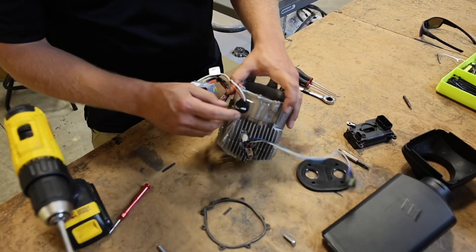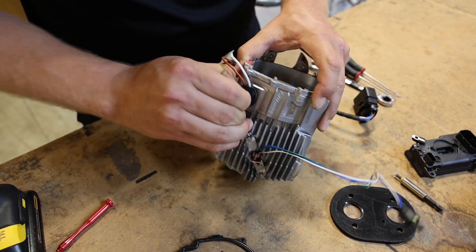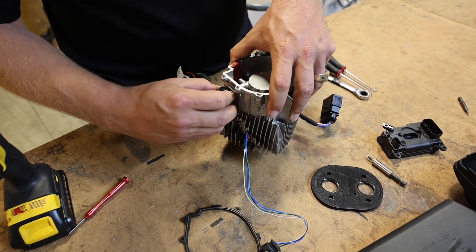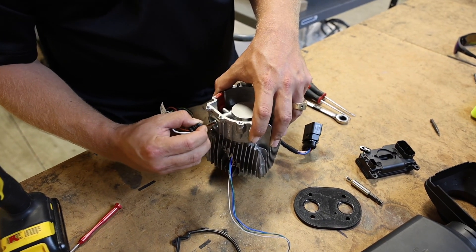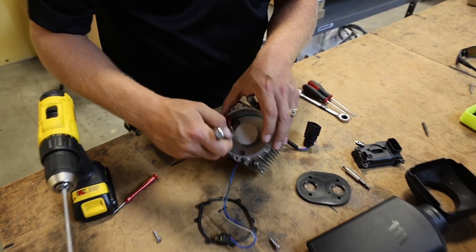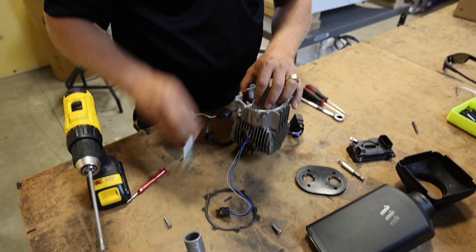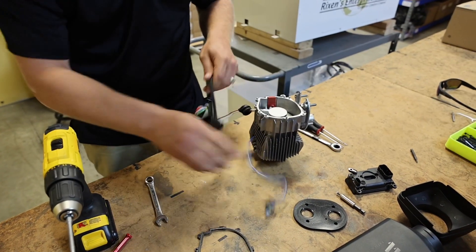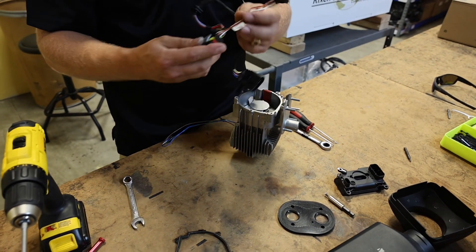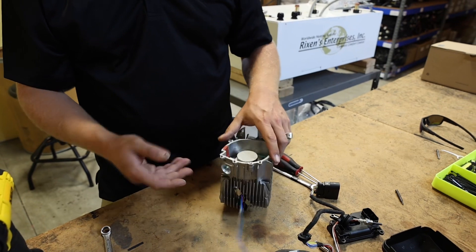Now that we're down to this point, there's a rubber boot over the glow pin wires. I usually will pinch the rubber boot and kind of just bend it side to side lightly, then going straight out — not pulling side to side anymore — sliding the rubber boot up the wires. Then I will take a 12 millimeter box wrench and put it on the glow pin and loosen it up. Because you have these wires attached, you kind of have to spin the whole thing around. If you wanted to get fancy, you could use a terminal removal tool and pull the wires out of the plug, but that's way more work than just spinning the whole unit around. Now the glow pin's out.